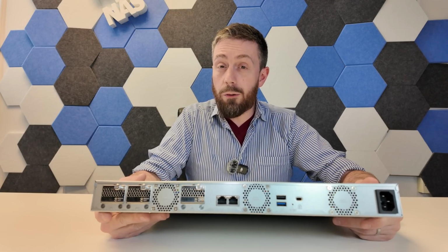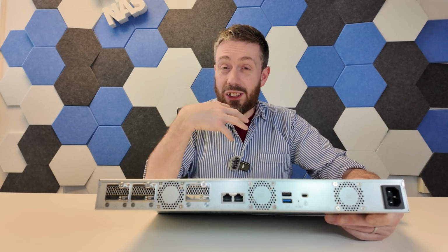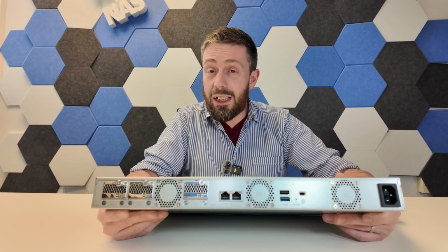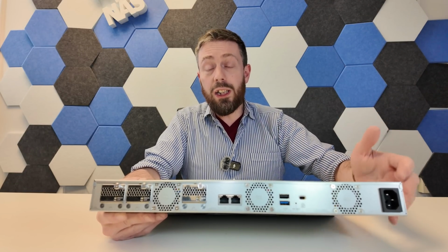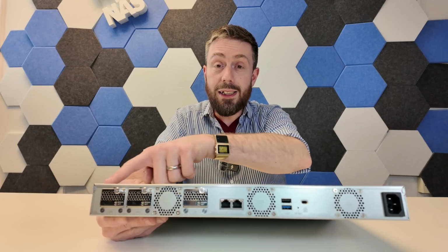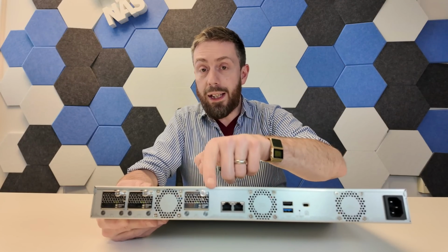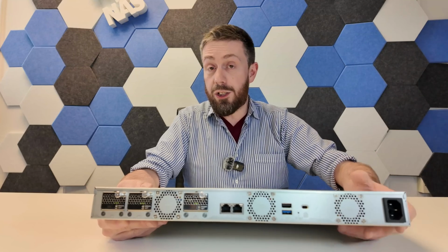This next one might seem slightly counterintuitive to the compliments I gave them, but you see these E1S upgrade slots? Again, I actually quite like them, but I know they're not for everyone because these kind of slots also mean that getting upgrades is pretty inflexible and you're kind of limited in most cases to QNAP's own upgrade accessories, locking you into an ecosystem a little bit too much. And I know there are users out there that would rather this system arrived with a single PCIe upgrade slot and 2 M.2 NVMe slots inside. I understand what they're going for here, and this is a very flexible device, but just keep in mind that these upgrades here are nowhere near as easy and over-the-counter purchasable as traditional PCIe upgrades.